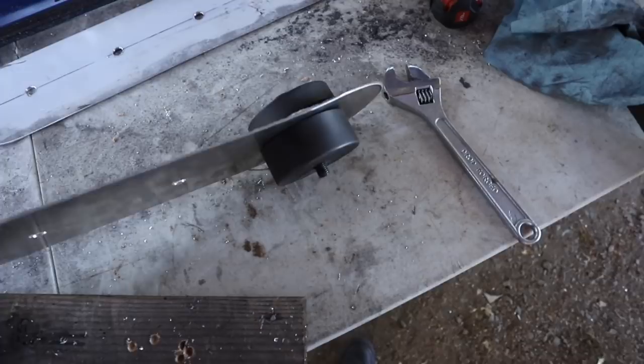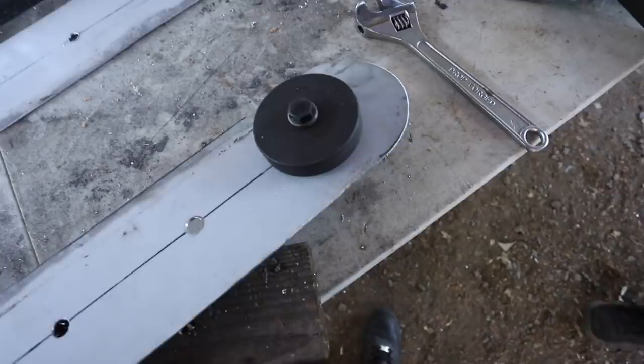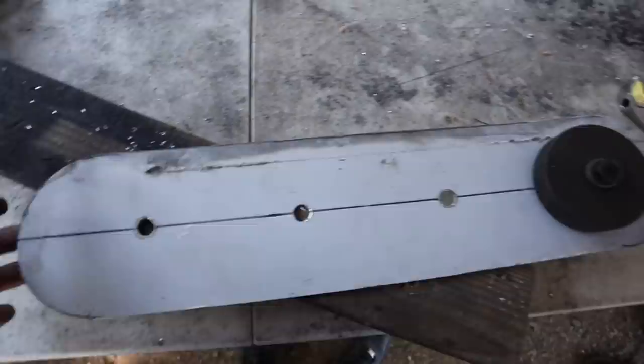Oscar also got the holes cut in the hood, and then he's got his design for the plates that he wants to place in there. They look like this, and then this is the dimple die that he's going to be using. This is an Eastwood dimple die that they actually provided us a while back. It's a 2.5 inch hole is what it's going to create. So Oscar's going to dimple die these plates up, and then they get riveted onto the hood, and they'll be all good to go.